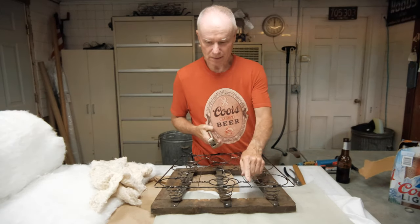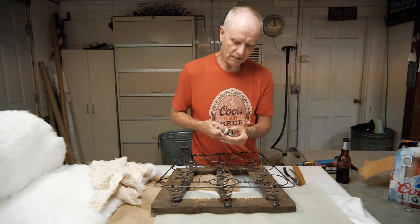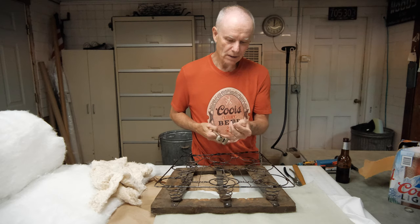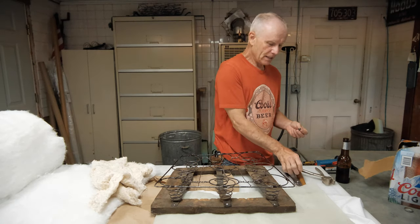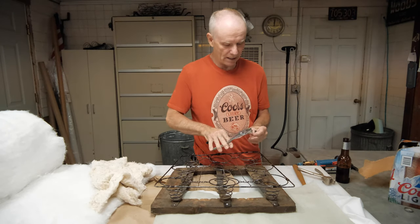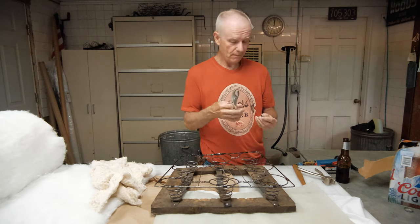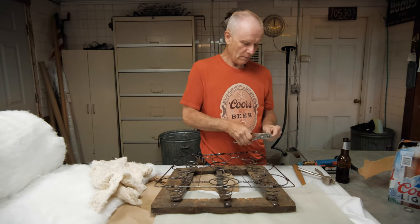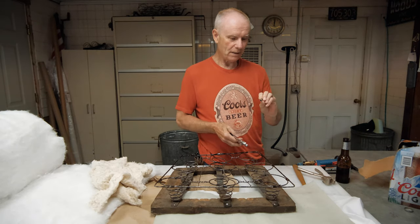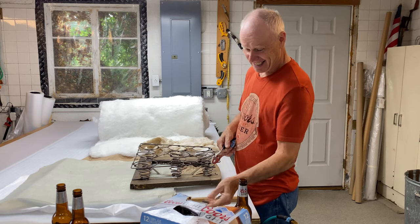They've used similar clips here. And you just crush it down, and it supposedly holds it good. I find that I always end up using regular pliers to finish it off. Bend it down there good. And in reality, this is all you need. But you do need the clips, which any nice upholsterer will give you a handful of.